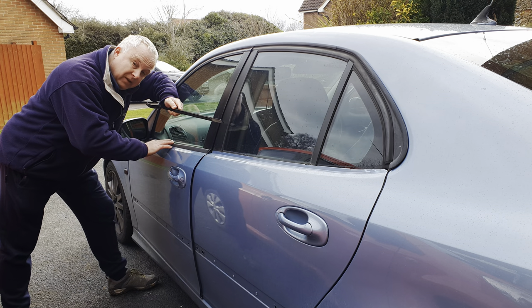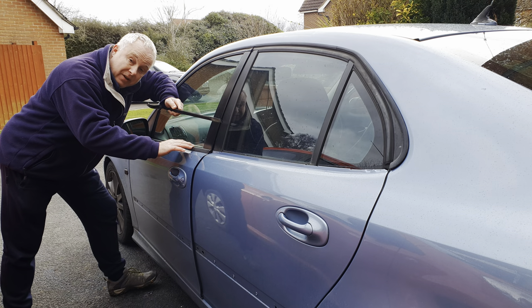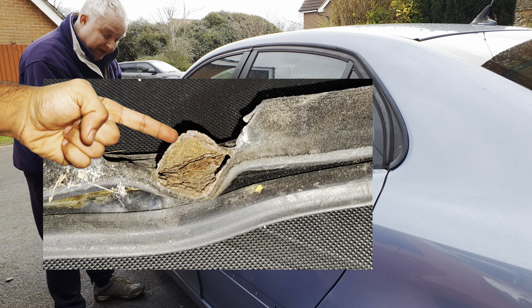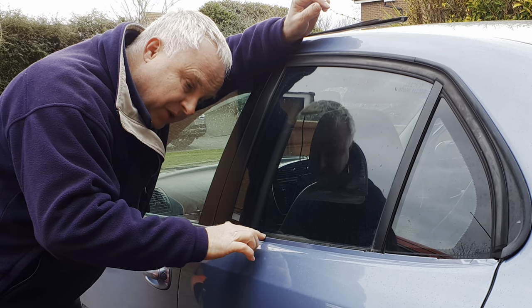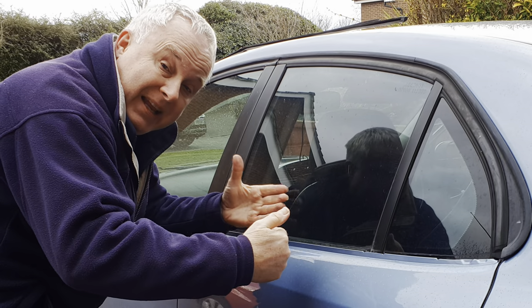My car door water seal along the waist of the door has deteriorated in typical fashion. The internal steel carrier has rusted, which is just plain ugly. The glass seal flip has lost some of its strength with age and the flange they are mounted to has crept outboard with pressure from the glass system.